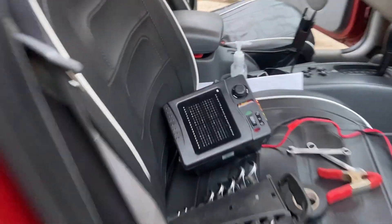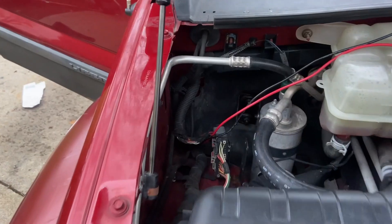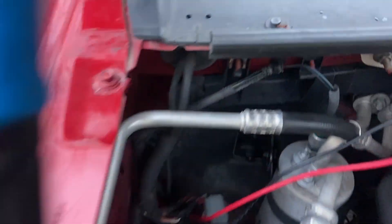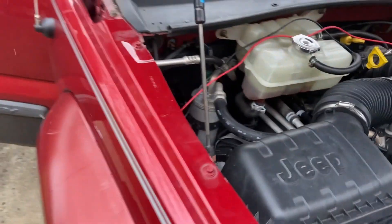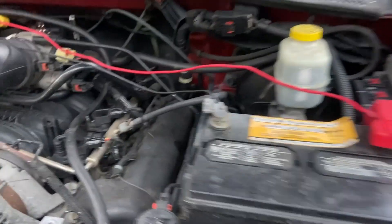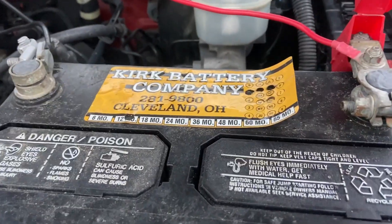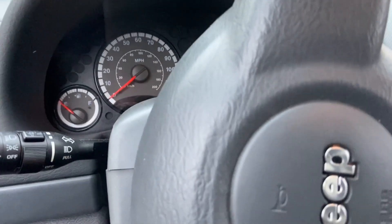The heater now has power, though I haven't turned it on yet. I have the wires routed for now — I'll figure out maybe a better way in the future. I'm probably going to put electrical tape down the hole at the firewall to make sure these wires can't get cut over time, because that would create a short situation, which is not recommended. We're going to start the car now and then run the heater — you should always make sure the car is running while the heater is on.